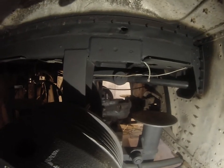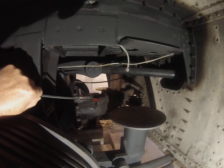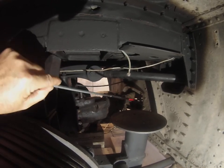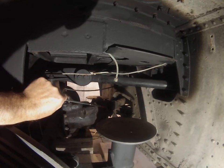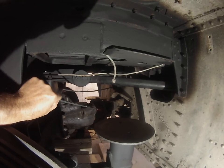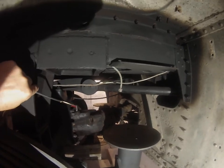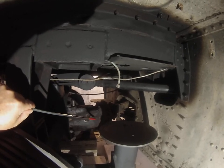Factory original in here is where the parking brake would live. This was the housing for the slack adjuster, this was a pivot for a linkage — a 90 degree linkage arm. The linkages went towards the engine where there were some other linkages to turn everything around and send it back to the cab. This flange right here originally held the brake drum on the drive shaft and the brake shoes lived around this area. When I got the bus the brake shoes were actually still attached, just hanging below the differential. This mechanism was all still here, kind of hanging around full of grease, just in the way. The brake drum was gone. So I went ahead and cleaned up, got rid of all the rest of the linkage and abandoned parts, so that those couldn't get in the way or rub on the drive shaft.